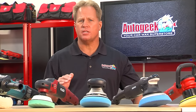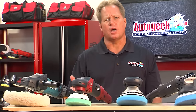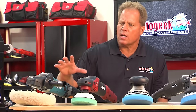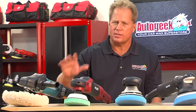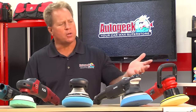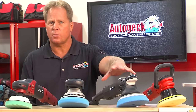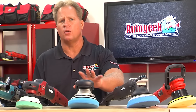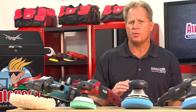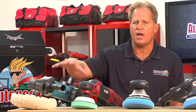If you're in the third category — you're a seasoned professional, perhaps you detail cars for money full-time or part-time, or you work in a body shop, or you just detail your own cars but you've been doing this for a long time and you know what you're doing — then we're going to talk about the rotary buffer. These are the tools with the most power, though you're still going to need a DA polisher for things like removing swirls or machine-applying waxes and sealants — options like the Griot's Garage Dual Action Polisher, the Rupes 21 Long Orbit Stroke Length Polisher, or the Flex 3401 gear-driven orbital polisher. But for really tackling severe swirls, scratches, removing sanding marks, or an extremely oxidized gel coat boat or gel coat motorhome, the rotary buffers have the most power.